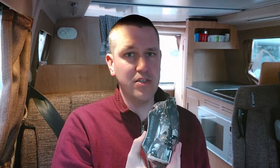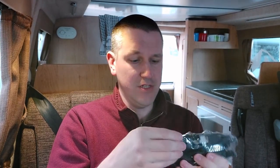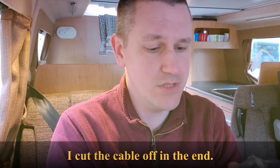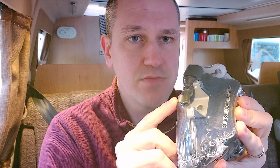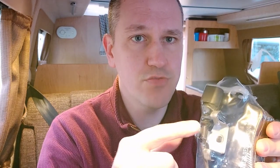The only difference is I believe on mine I don't think I've got the brake pad warning sensor as part of my campervan, so I believe you just clip these out of the way if you haven't got it. They've got a clip on the back so you can clip them out of the way — it's always cable-tied so it's not going to be in the way, or worst case you could even just chop it off if you haven't got the connection. Most T5s, particularly lower spec ones, would just be one spring. I believe on the ones with the larger alloy wheels they have two springs. I've got larger alloy wheels but I fitted them aftermarket — they're still the standard brakes. I'll put some links in the description for these brake pads and also a lot of the tools I use.